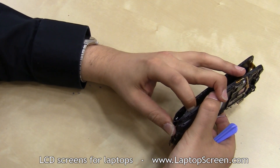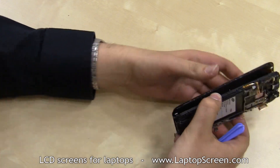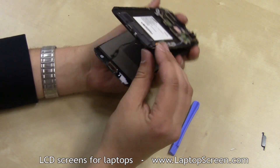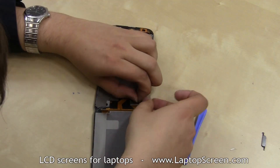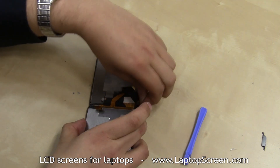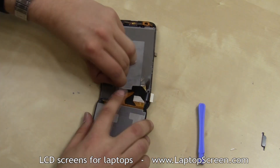Once the bottom edge is separating, make sure to properly unglue the buttons and the connecting cable from the glass digitizer — those need to stay with the front assembly. Also, the digitizer and the display connector board may be glued with the display adhesive tape, and will require a bit of attention to separate properly.